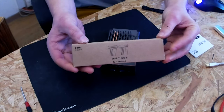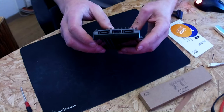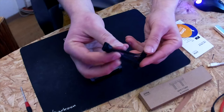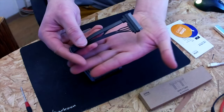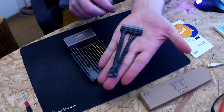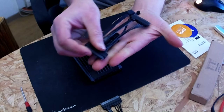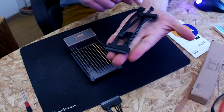Here is a SATA Y-cable so you can connect up to two SATA drives, because on the back there are two SATA ports. You only get one power connector, and you can use the interface cable that comes with it — which can connect one drive — but there is also this Y-cable so you can connect up to two drives at the same time: one power connector but two SATA connections.